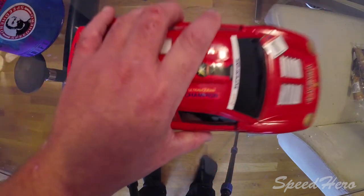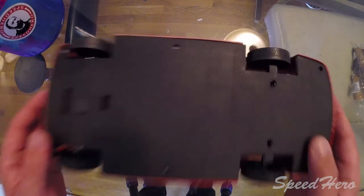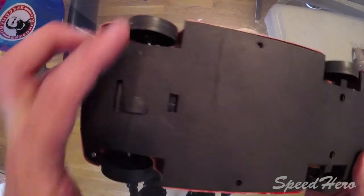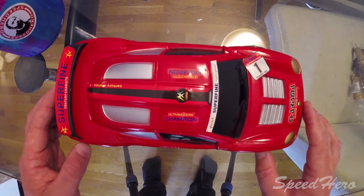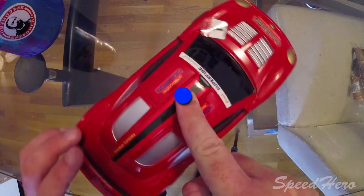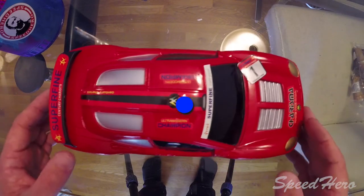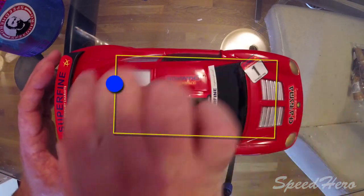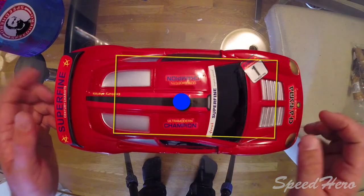You'll see it slides exactly sideways. That's because this car has a matched grip in the front and the rear — we've got plastic tires all around. Your car has a floating pivot point. It's the area where the car pivots when it initiates into drifts or makes changes or directional adjustments. This pivot point floats around inside of this box.